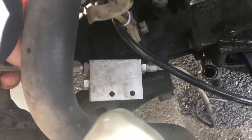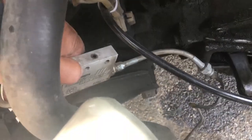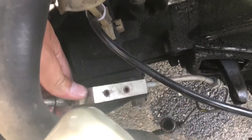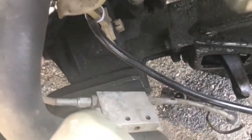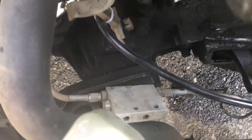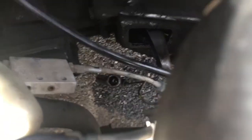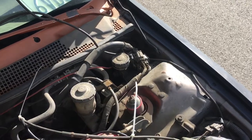So in here — I can't really get a good angle on it — there it is. That is a clutch master's flow control valve. It's supposed to help you with launching and stuff like that, ease up on the clutch pressure. I'm going to take that out and replace that whole section of line. And as you can see, that's the slave cylinder down there. The clutch master cylinder took a dive as well, so I've got to take that off.